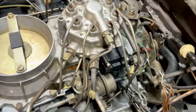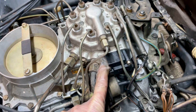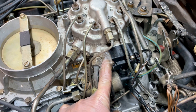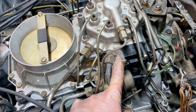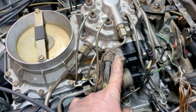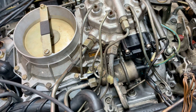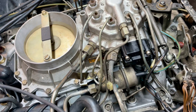Unfortunately, the next thing that happened is — since I fixed the EHA valve and restored the pump, fuel filter, and the fuel accumulator — the fuel accumulator is really nothing but a membrane which is spring-loaded. The pump will pump into it, and when you turn the pump off, the check valve will cut off any reflow into the pump, and then it will push pressure to the hoses to keep that pressure alive through the spring which pushes against the membrane.